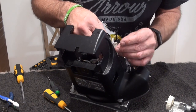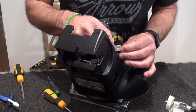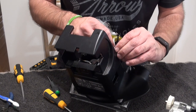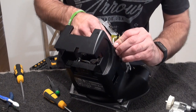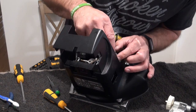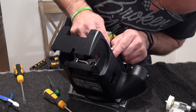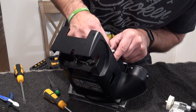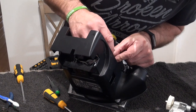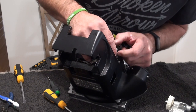These wires, we can now do our 1, 2, 3, 4. So I've got them two there, so they've all moved around. So good job. Mark them up. On the later model, so on the Centria, they are colour coded, but on this one, for some reason, there was just one coloured one. So we'll put number 4 on first. So it's right at the bottom in the light. Then number 3. Then number 2. And then number 1.